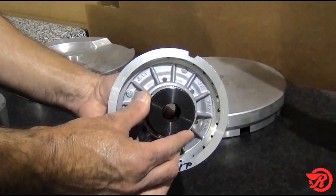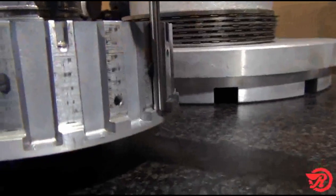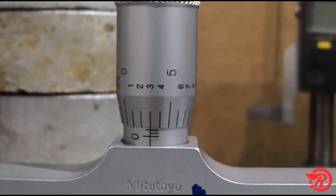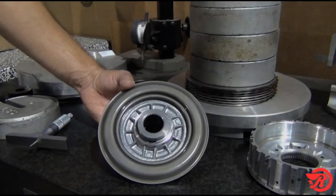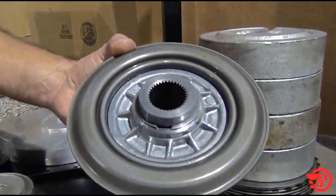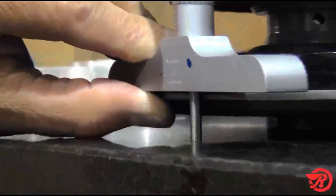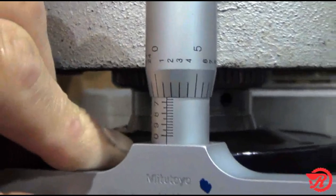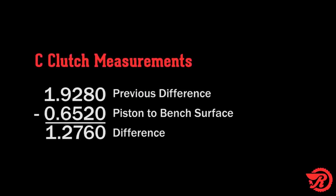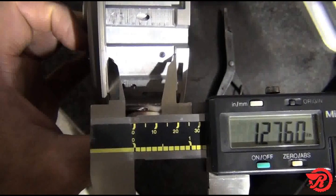With the inner hub inserted in the C clutch drum, place a suitable bushing driver in the hub and place it on a bench. Using bar stock, measure to the bottom of the spline — our measurement is 2.928 inches. Subtract the bar stock height of 1 inch, and that should equal 1.928 inches. Remove the hub from the drum, install the pistons on the hub, insert the snap ring, place the hub and pistons upside down on a bench, and measure from the piston to the bench surface. Our measurement is 0.652 inches. Subtract that from 1.928 inches, and the total is 1.276 inches. An alternate method is to completely assemble the pack without the clutches and use a vernier caliper to measure.